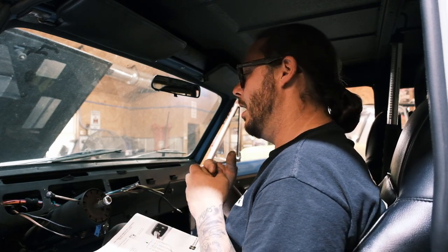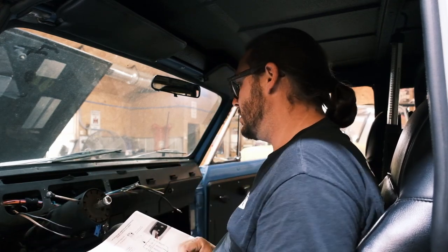Not to mention what you're doing to the alternator. I think that's another thing that people don't think about, is what the alternator is actually rated for. Alternators are rated for a specific amperage output. When you upgrade the alternator on one of these things, you need to add a means of getting power back to the battery, not through the factory system, or you're gonna cause issues. It's a conversation for another day, but worth mentioning.